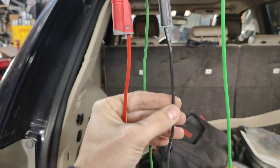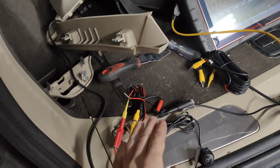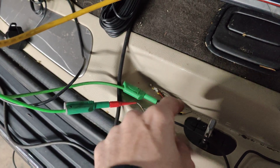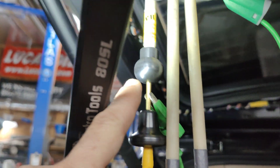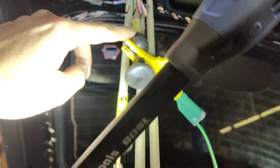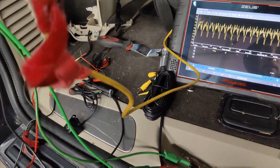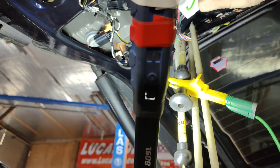Following it down, it goes to ground — you'll see this clipped right on the ground. For video, I have this cable with the end cut off — we have black, yellow, and the red is not used because red is just a trigger for reverse lights. Yellow goes into the green wire, which clips onto our yellow wire coming up to the green and brown. The green and orange comes down into the signal return. So we've confirmed 100% a bad backup camera — unplugging it doesn't change the video on screen.